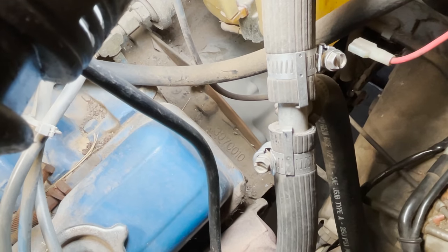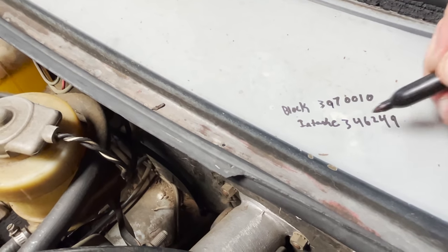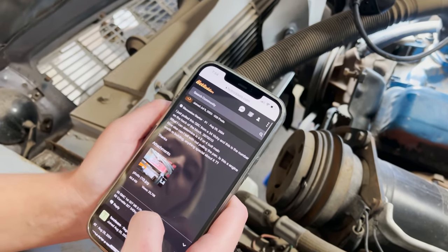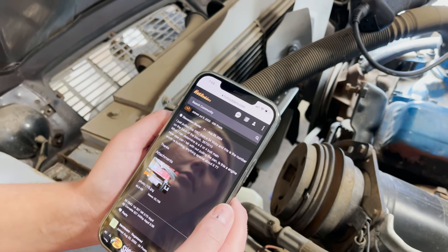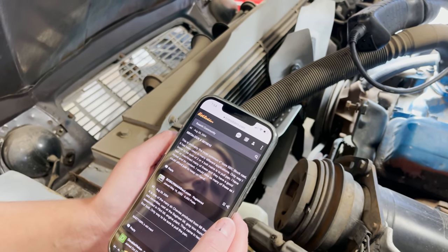There's the number on the back of the block. Looks like 3070010. Actually, 397. Got to fix that. Take number one off Google from 2004, see what we can figure out here. It's a two-bolt or a four-bolt main. Anything special about it. This is probably the most common four-inch bore small block Chevy block casting.